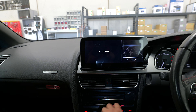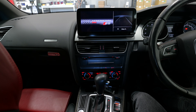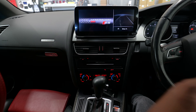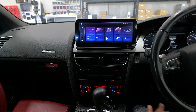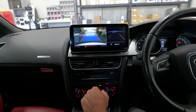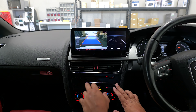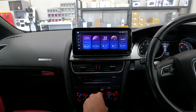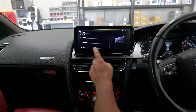We had a 'no signal' situation, but fixed it in real time by turning the car off, opening and closing the door, and turning it back on. With all the fiber optic unplugged during install it just needed a reset. Now it's back in Android automatically. Going to reverse — the factory camera shows up just like that. The speed isn't blazing fast but that's the factory MMI system — the Android unit is simply switching you back to the original camera feed.